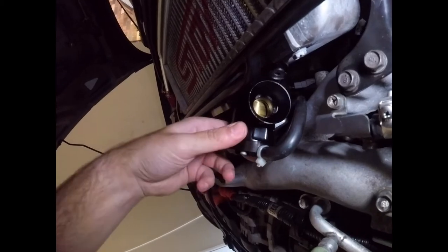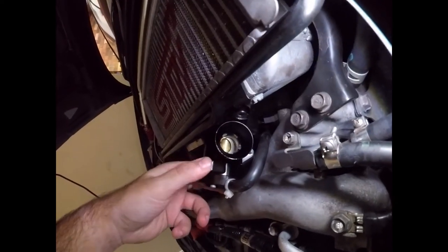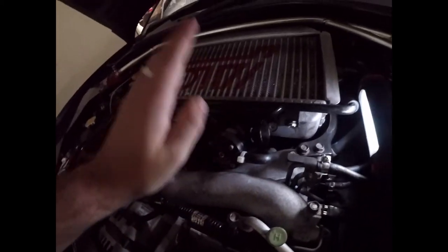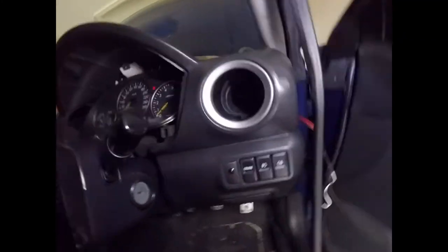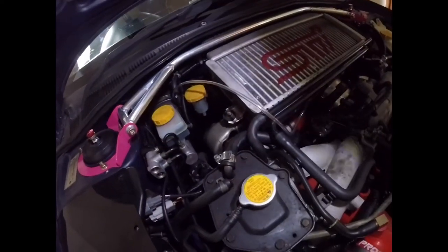If you turn this, as you can see it closes — so you can have it half ventilated, half atmosphere, half whatever. It's entirely up to you. Go to Subie and get one of them, you're worth it. Now getting this off and mounting the gauge cup. I found the two wires I'm going to use off the old gauge and had to pull the whole cluster out to get this thing in. As you can see, we've got the hose routed in through the firewall and around there — it'll be tucked up above and kept away from the turbo as much as possible.